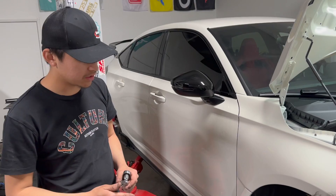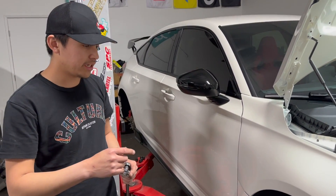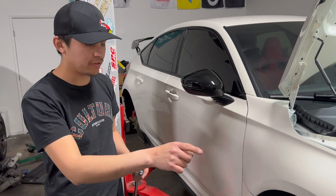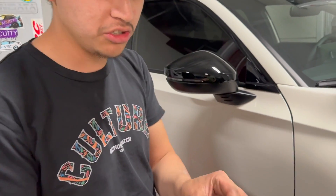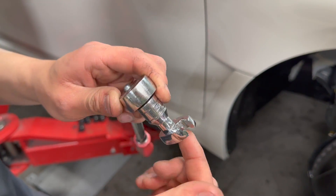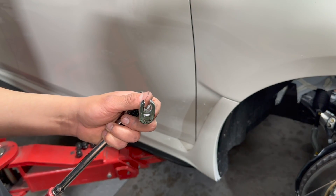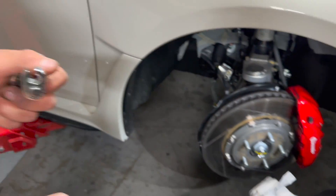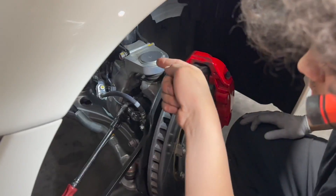We're starting on this side now with the Spoon upgraded brake lines. What we're going to do right now is remove the hard line from the brake caliper to the valve body. We're going to use a crow's foot — basically an open-end wrench. Morris is going to apply some pressure underneath so we don't bend the line downwards and break it. When I push up, this whole thing goes up, so you need to push down.